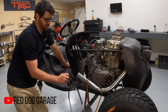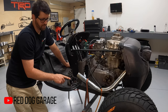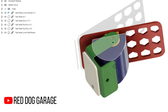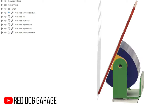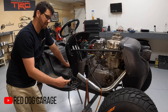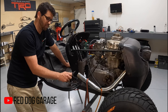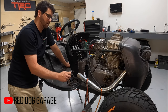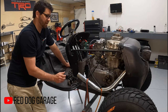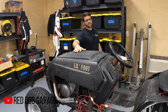Now every high-speed lawn mower needs a gas pedal to go real fast, so I made one. We've got a gas pedal that I designed on the computer out of a few different pieces — it's primarily a 16-gauge piece of sheet metal that is folded together, a few pieces of eighth-inch plate steel for the pedal itself, and a 3D printed drum that the throttle cable actually wraps around, which gives it its pulling strength. It's all hooked up, the carburetors are moving, and I'm pretty happy with how this turned out.